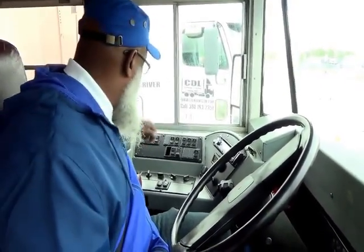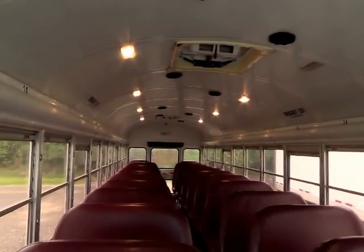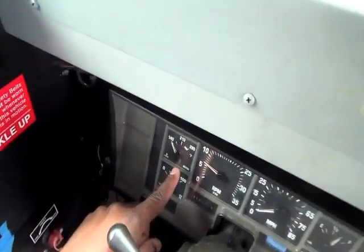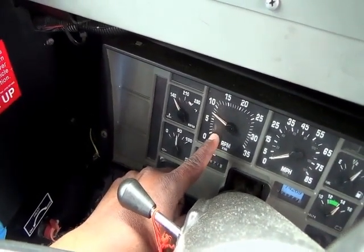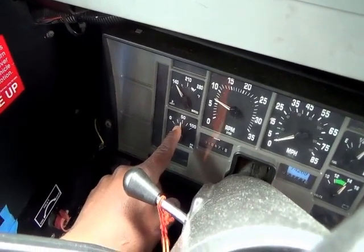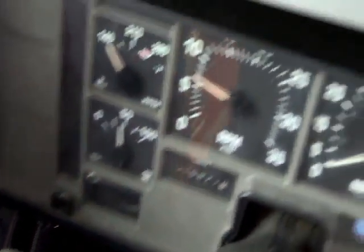So speaking of interior, you have your interior lights. So your interior lights properly work, okay? And your dash, you have your oil pressure gauge, your temperature gauge, your RPM should properly work. And the temperature gauge rises when the engine warms up. Your oil pressure gauge should reach roughly around 50 to 60 PSI on the oil. And then your miles per hour, that would move when you roll it.